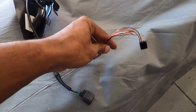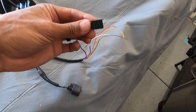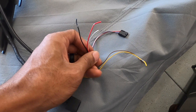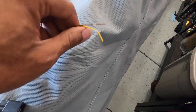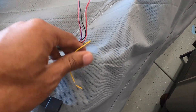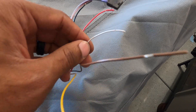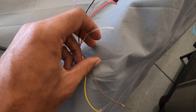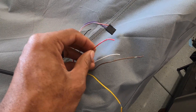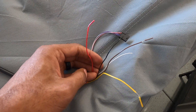We made our way outside and before we do the fuel-related stuff, we're gonna take care of the electrical. This is the power harness coming from the gauge itself — it'll connect to the sensor. We're really only gonna pay attention to the red, the black, and the white cords. The brown and yellow ones are for external data loggers or other inputs/outputs, so I'm gonna tie those up and tape them off. The white one is a dimmer wire — you can wire it to a headlight source to dim the gauge when headlights turn on, but I'm not gonna worry about that either. For the power wire I have a little switch which goes to a fuse box so I can manually turn it on and off. Simply these two together — one to the power switch, one to ground — and we're good to go.